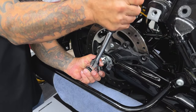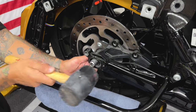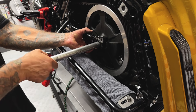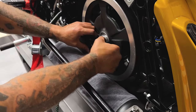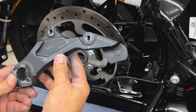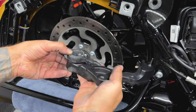I'm using a 36mm socket to remove the cone nut. I'll knock the axle through and pull it out. You have one spacer — just keep track of that. Here you have your caliper bracket and your wheel speed sensor; just work that out. When you go to remount your wheel speed sensor, it mounts just like this — you have this little indentation here, that's where it sits. Just make sure you remount it the same way.